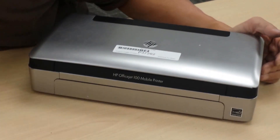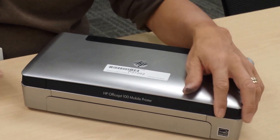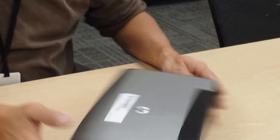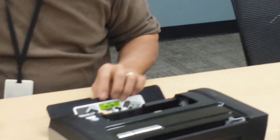How to take apart an HP OfficeJet 100 mobile printer. First thing you do is take off the top cover — you bend it in the middle and it unsnaps. There are two little clips that fit in two little holes there. Then open up the cover.